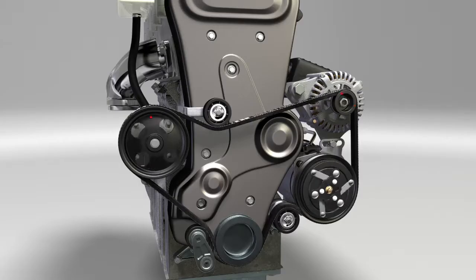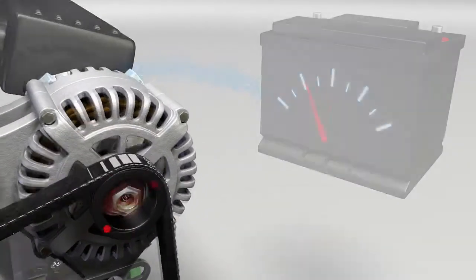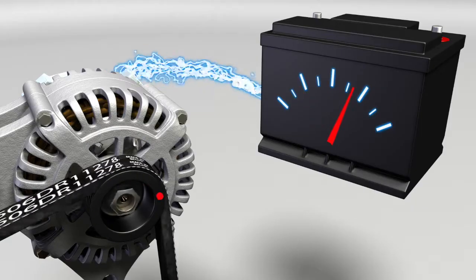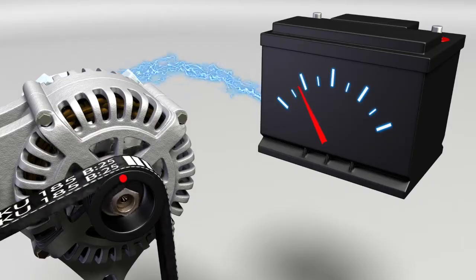Many times another component will fail. If the belt tension is too high, it will put a lot of stress on other bearings in the system. For example, an alternator bearing might fail because too short of a belt or a non-original equipment style tensioner is used. If the belt tension is too low or the belt is too long, belt noise will be created by belt slip. This indicates the belt cannot effectively transfer power and now all of the accessories in the system are operating less efficiently.